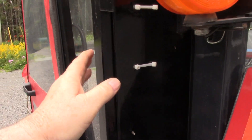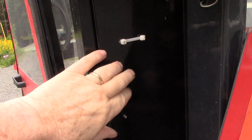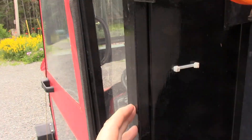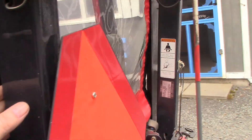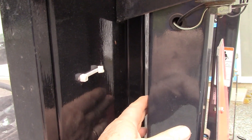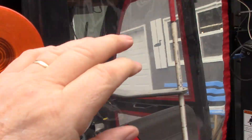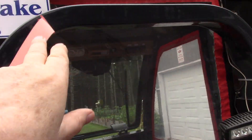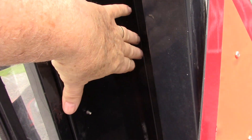The rear post was incorporated with a piece of sheet metal here. There's a bend in it right here, and that's connected to this rear post. Then there's another offset in here — it's hard to show that — but that's just a double offset right in there. What that does is it allows a little recess to put the back window in. So the back window fits in this recess, and that distance there is seven inches — seven inches with a one inch double offset that makes an L bend in it.